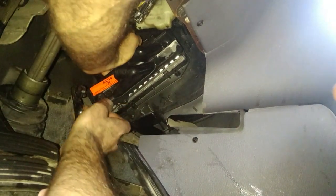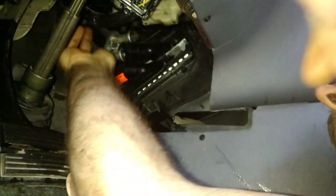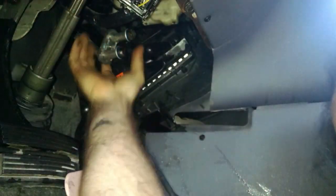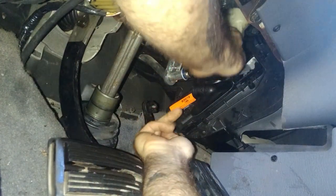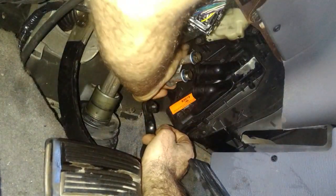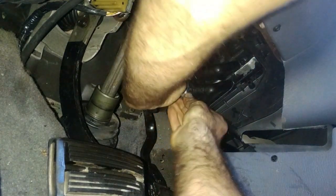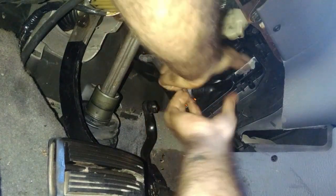Now we just got to get these clips back on. Probably want to get these hoses out from behind here. There we are. That's it. We didn't have those screws there. Some might have an 8mm. So here we got our old rings that are good. We slip this back in here. Wiggle that all in there so it's snug. We don't want to tear any O-rings. If they're fresh, wet them.